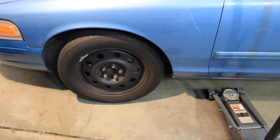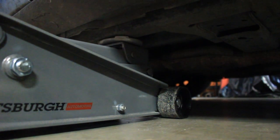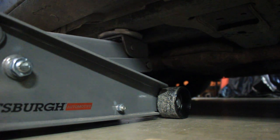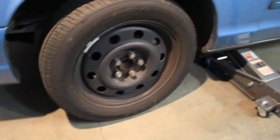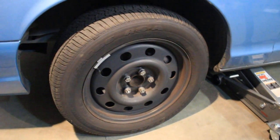To give you guys an example, I'm going to be taking this wheel off — these bolts are torqued to about a hundred pounds. The first thing I'm going to do is jack it up. I didn't jack it up all the way, just took a little bit of the weight off. You don't want to jack it all the way up because then the wheel will spin and it'll be tough to get enough torque on the bolts. Leave some weight on to start, then get it up in the air once they're loose.